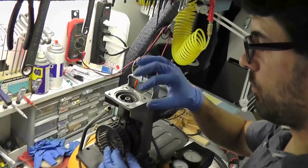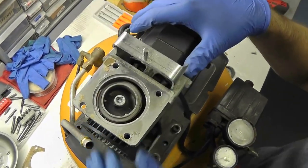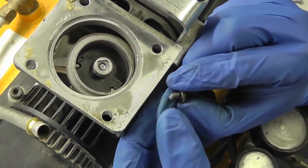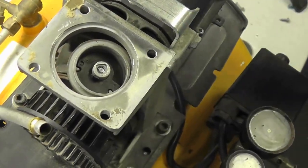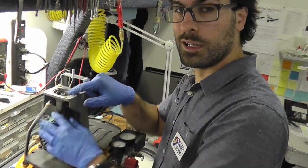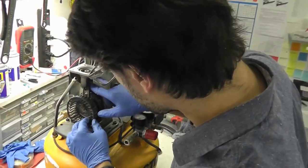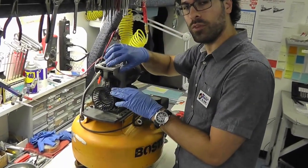Now we can install the new cylinder barrel and compression ring. When I removed the old piston top's torque screw using impact, it sheared right off into the threads — that's pretty common and may well happen to you. There's no easy way to remove that screw from the rod, so we'll replace the rod itself. It's part number AB-610101 — a very inexpensive part. Use a 4-millimeter hex Allen wrench, and note it's a left-hand thread, so you turn clockwise to remove it.